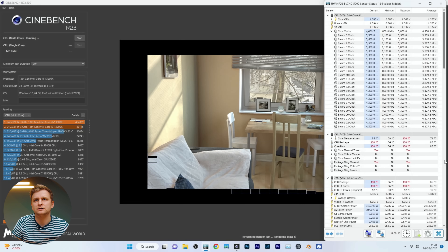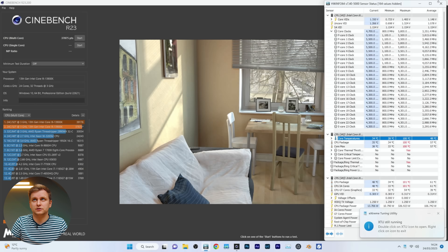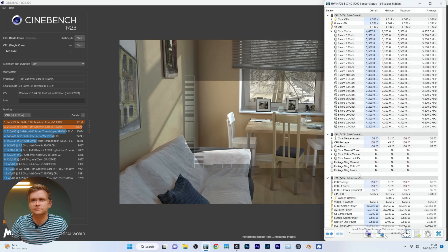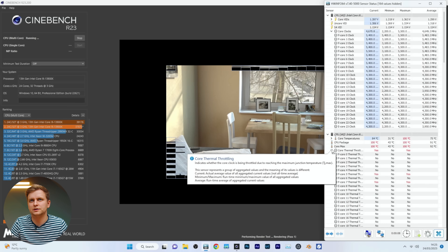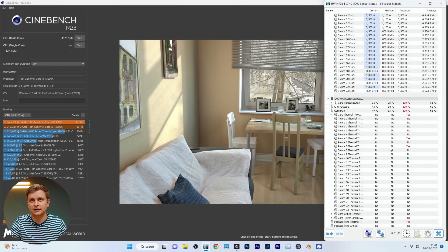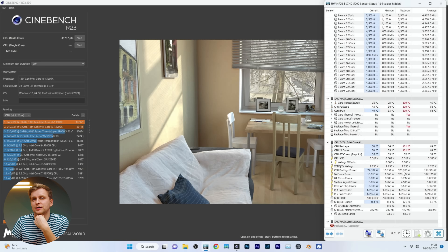P-cores are quite high — around 40,000. Just to show you before the test: the Turbo Boost and Turbo Power Max are all unlimited, PL1 and PL2 limits are unlimited, Turbo Boost time window is 228 seconds. We have thermal throttling — two cores hitting TJ Max. The throttling was really on P-cores 7 and 5. Maximum power pulled was 328 watts.